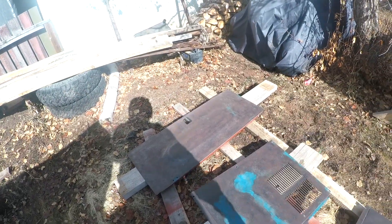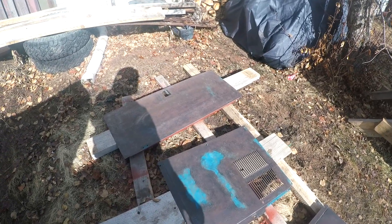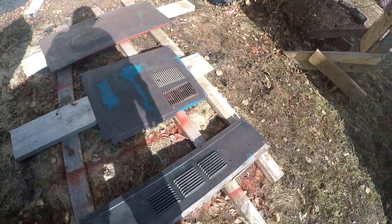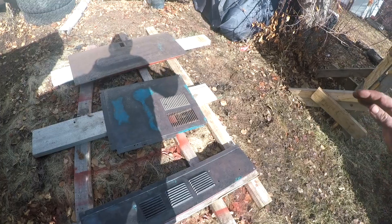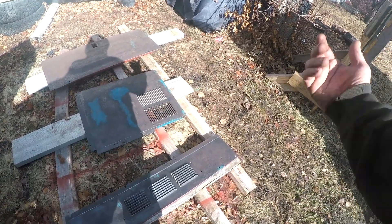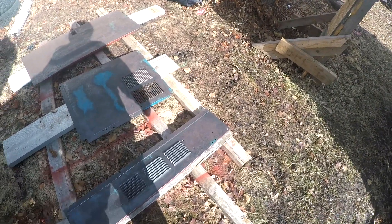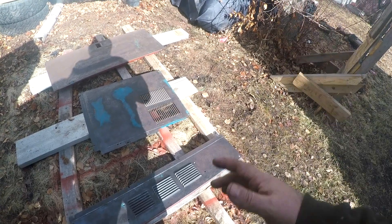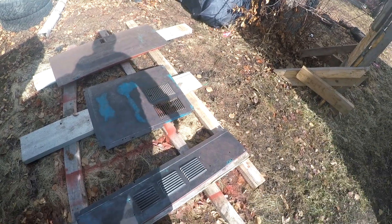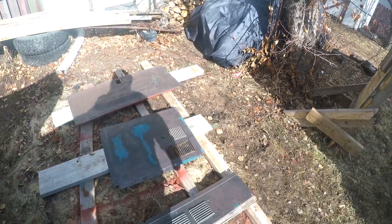Everything else — the paint was totally gone, you could just scrape it off. There was rust, this is actually fairly deeply pitted. It must have been a powder coat because powder coat will do that: once moisture gets in behind it, it'll just leach in behind and rust from the inside out. All of a sudden something looks fine and the whole sheet peels off and all you're left with is rust. Same with spray-on rubberized undercoating — very bad for that. Guys spray the whole top of truck decks with it, it looks great, then the corners start peeling up and you peel off the whole sheet of rubber with nothing but rust underneath.